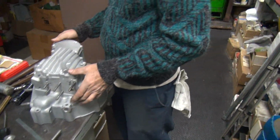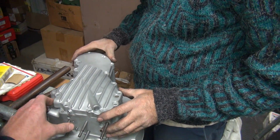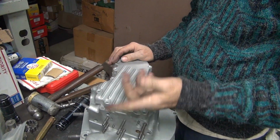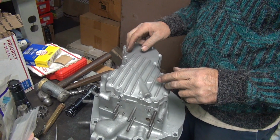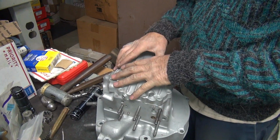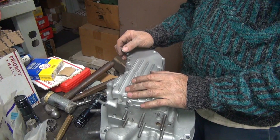Is there anything we can do to tighten that up? Not really. These won't help lock it in too? Yeah, but they're all fighting each other too because screws are not concentrically made. The dowels are supposed to align the stuff. So no, there's nothing you can really do about it. And after you put everything on there and tighten it down, you don't know what you've got to do to make things free up.